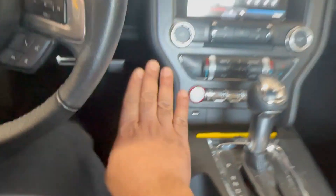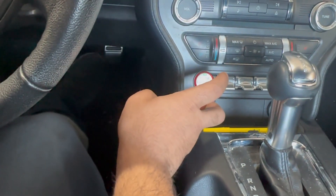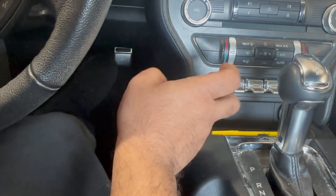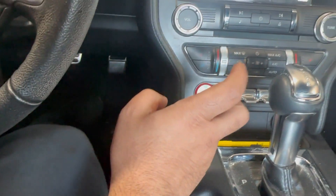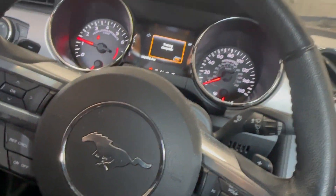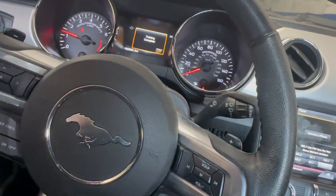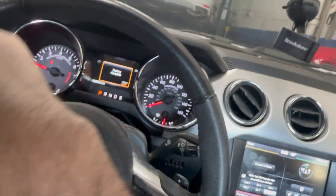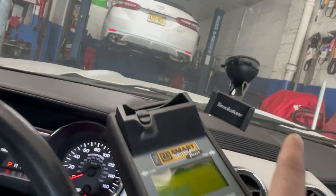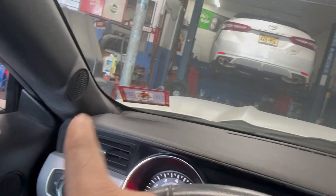Press the brake pedal down, let it go, then push this five times — one, two, three, four, five. After that, press the brake pedal one more time and let it go, then push this six times. It's going to go into a training mode. A lot of cars you can let some pressure out and each sensor will activate, but all I do is go to each wheel and scan the sensor — it's going to beep.